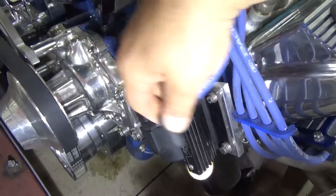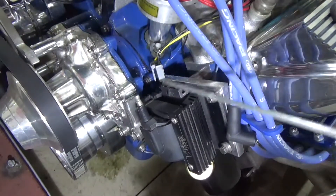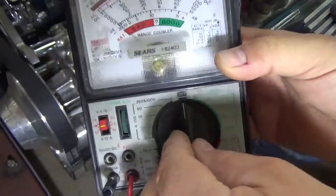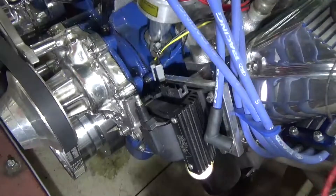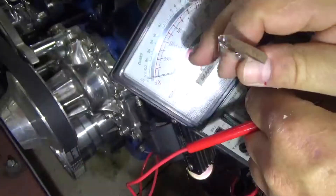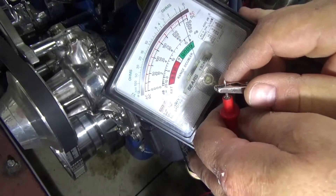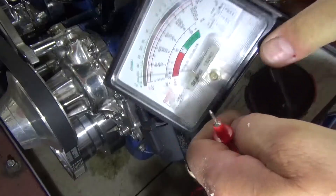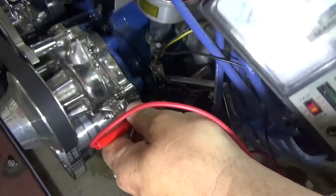Testing the coil is pretty simple. First, take off your coil wire and the connector, because the terminals are inside the connector. If you have a regular coil, the positive and negative will be on the outside. I have my voltmeter here and I'm going to set it on resistance to look for continuity. When I touch the positive and negative leads together, you can see the meter goes up — that means I have a solid connection. I'm looking to make sure the meter goes up when I touch it to my coil. If it doesn't, the coil is broken.